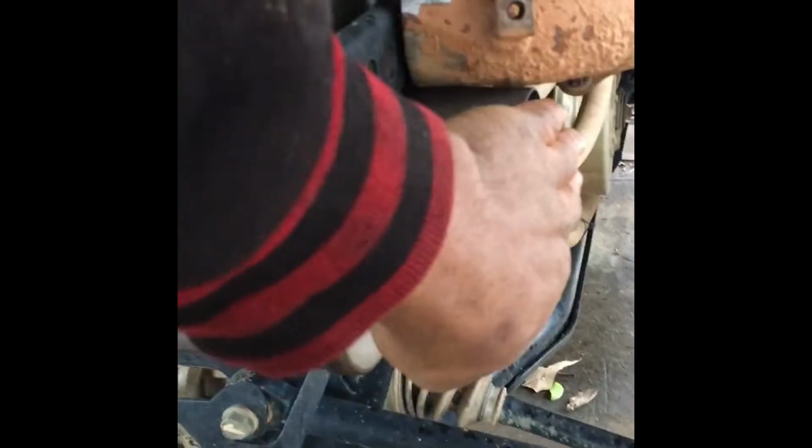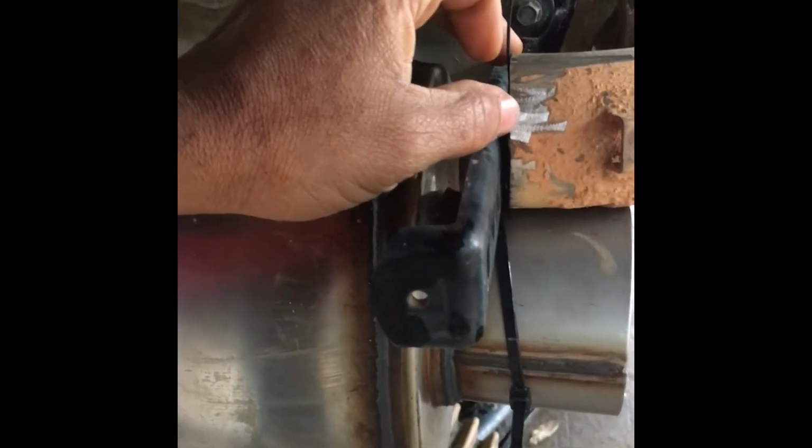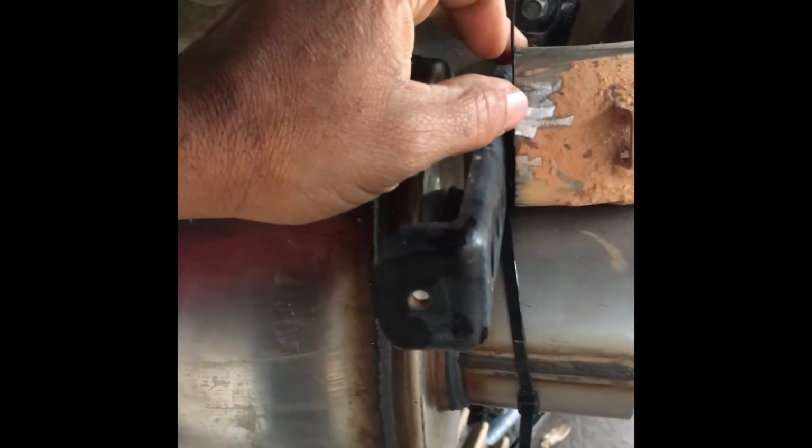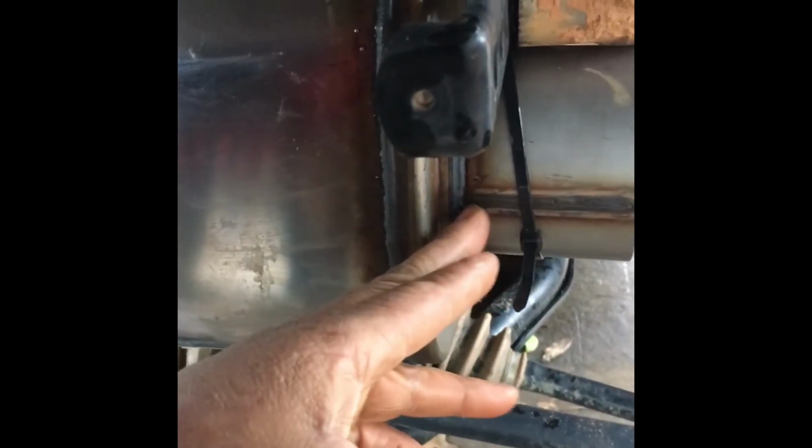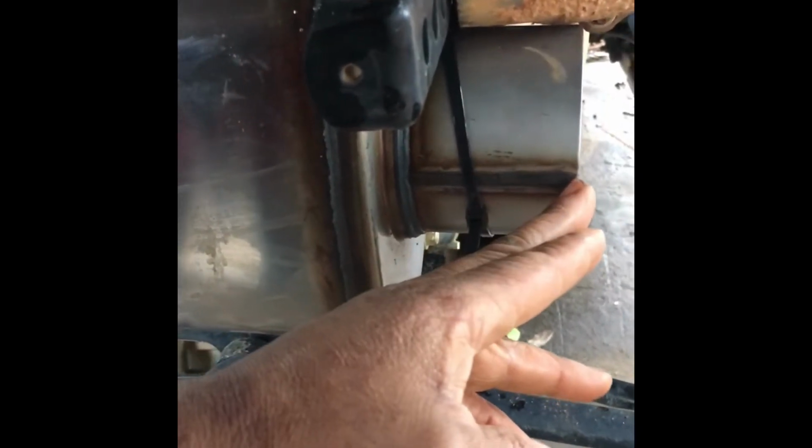take two inches off of this, and then I'm gonna weld me a plate right there, and inside that plate I'm gonna cut me another hole that's gonna be 2.52 inches, and it's gonna go inside that plate right there. It's gonna look real clean and nice. And it's probably gonna be about right there. That's about an inch right there. And then from here on out, it's 2 inches. So I'm gonna cut 2 inches off and then put a flat plate right there.